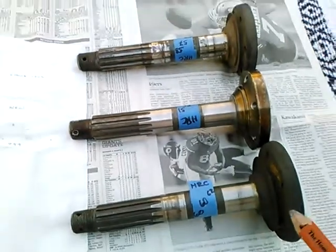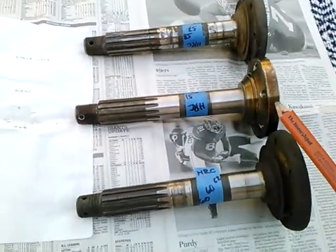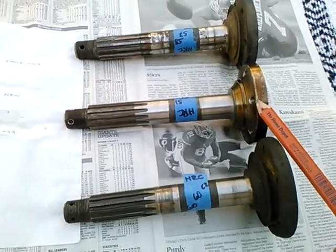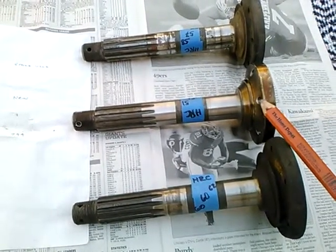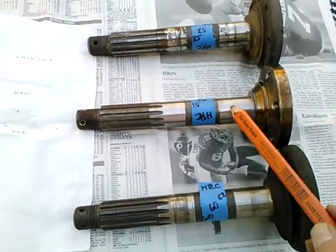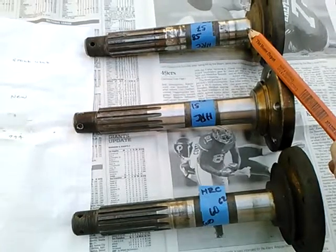The strength of steel trends with hardness. So while I haven't had the wheel break off of the car with the aftermarket stub axle, it does concern me that the product being marketed is not as strong as the stock part it replaces.